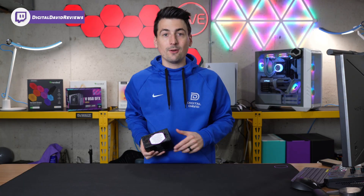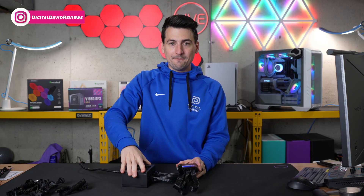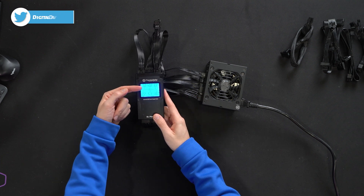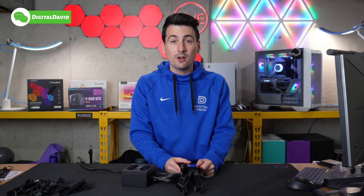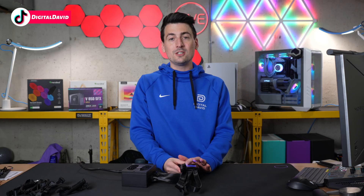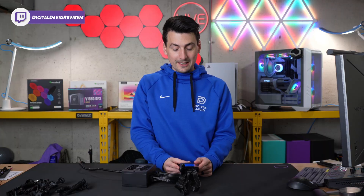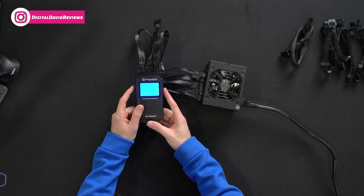Let's go ahead and power it up. We have the power supply plugged in and powered on. The fan has not spun up yet because it's not hot enough under idle load. We have our tester connected. Let's check out the motherboard cable connection: 5 to 5, 12 to 12, 3.3 to 3.3, 12.2 to 12, 5.1 to 5, and a PG score of 160 milliseconds — blue is good. Everything is within range. For the PG score, you want to see a value anywhere between 100 and 500 milliseconds. Now looking at PCIe: 11.8 to 12, blue is good, everything to spec. CPU: 12 to 12, all good there as well.